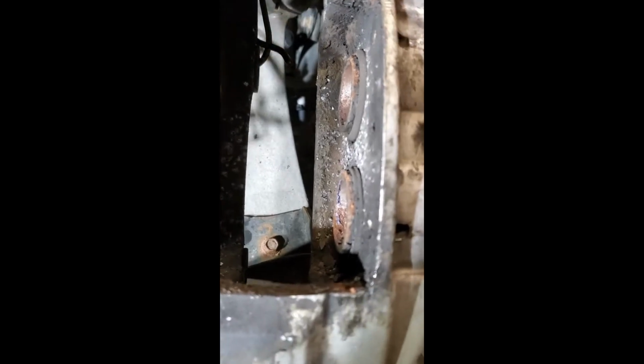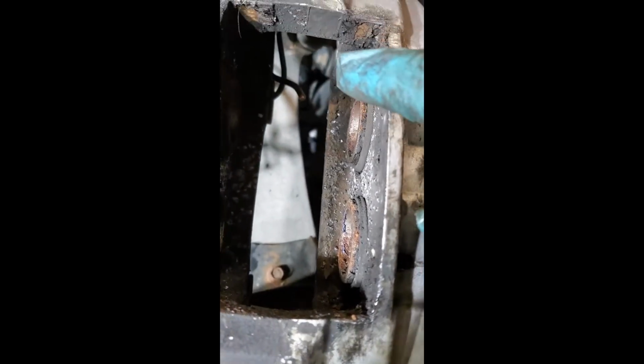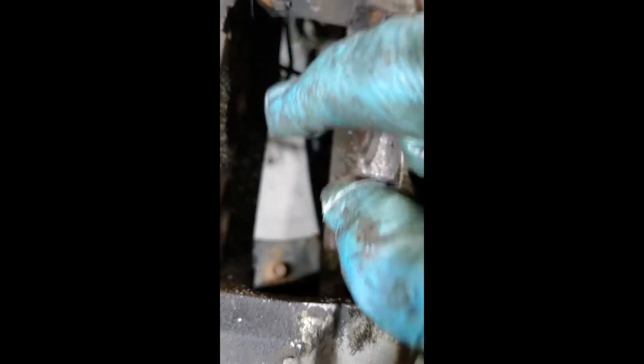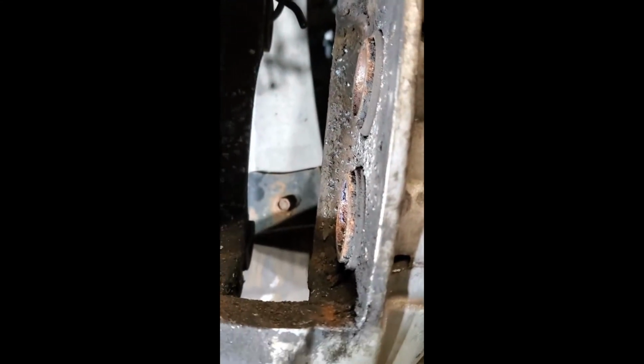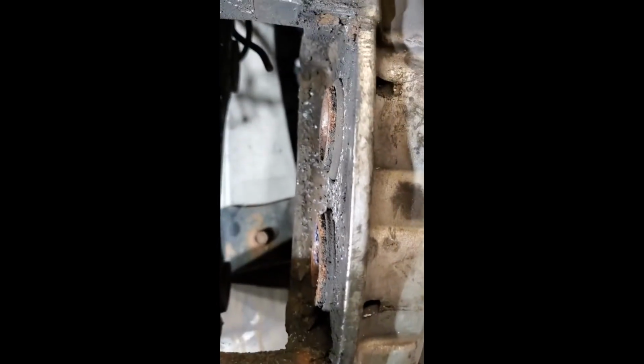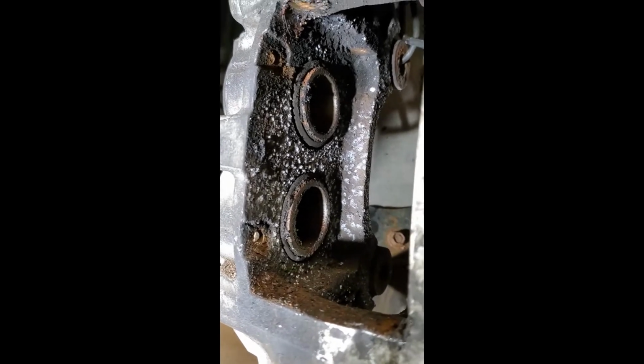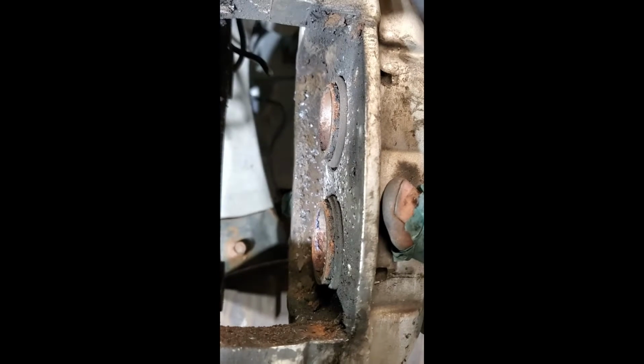The other thing is the glides where these things sit in. You can see it's getting pretty rough. These touch points need to be cleaned up. So what we're going to do now is just use some brake cleaner and polish. The pistons have pushed back pretty well. I might do just a little bit more just to make sure that they're pushed back.